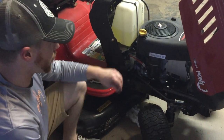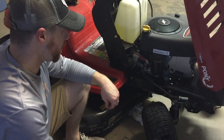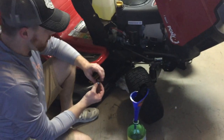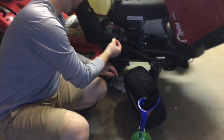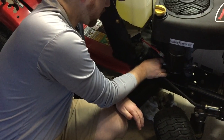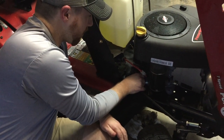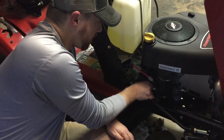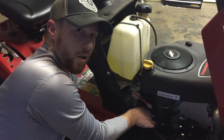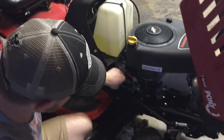Alright, all the oil is drained — took about four minutes. There's a little leakage in some spots, so make sure you clean that up so you don't get that smell later when the heat comes up. We're going to put our bolt back on, going clockwise. Make sure you do that easy so the screw goes in correctly. Be cautious of how hot it can be — this has been sitting so we're okay, but if you let it run earlier, just be careful. I've got that hand tight, now we're going to snug it up.